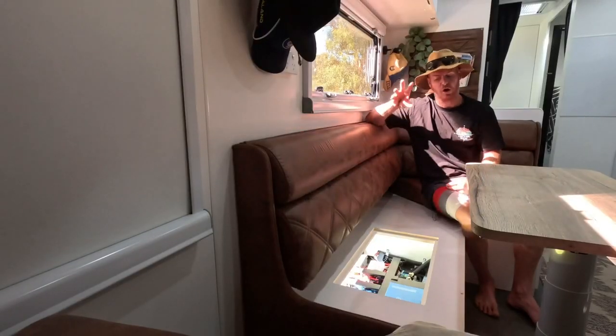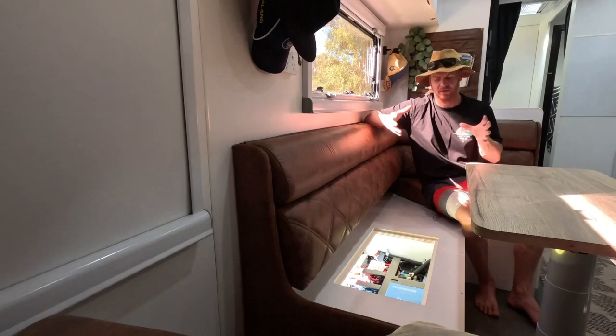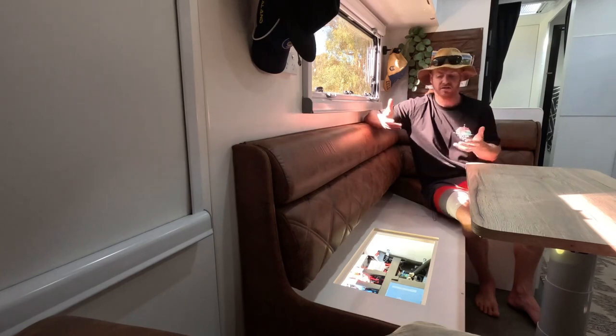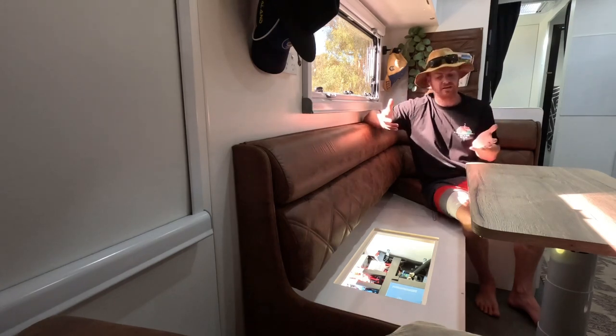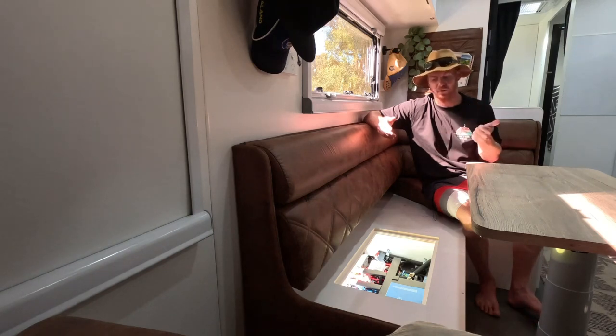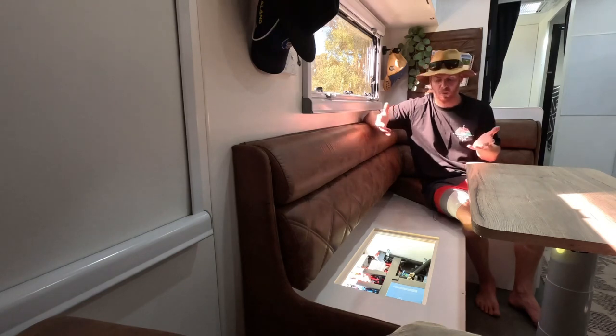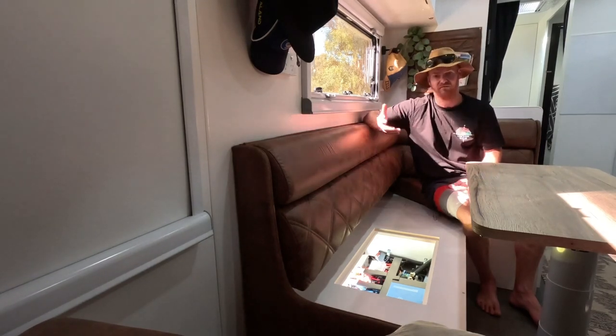So I've designed this with Solar for RVs, who made the pre-wired kit for us, around redundancy. So we've deliberately put in 2 of a few items. Not just because of the size of the solar panels that we've got, but we've also put in 2 solar chargers. So if for some reason something does fail, because you do put this stuff through a lot of vibration, not that we expect anything to fail, you're still going to be able to bring in 50% of your solar. Also, I've gone with 2 DC-DC chargers. 2 reasons for that. The tow vehicle will cope with that. But second of all, if for some reason I do have a problem with one and I'm waiting for the new one to come or something, then I've got the other one that's going to be able to do the job. Keep bringing in 50%.